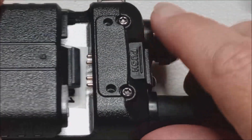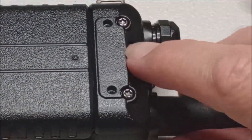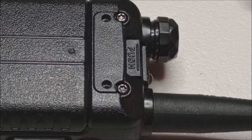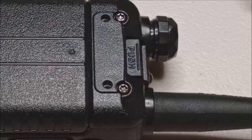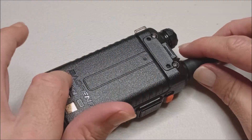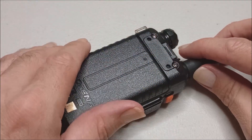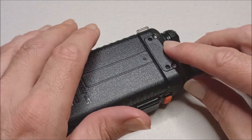Let's put a battery in here. Pop it, see if she comes out easily. And that's it reassembled, except for the belt clip — we'll not show that at the end of this video. That was relieving a stuck battery without having to pry it, by removing the trim and battery release button. Very important that you reassemble this correctly to make it work in future.